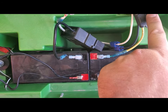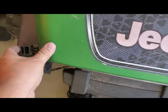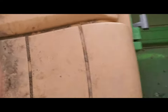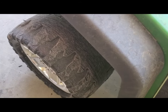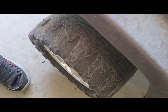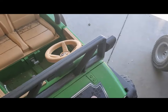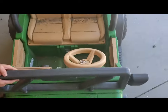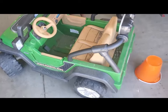Now if you close the hood, lock it up, and go over here — let's go to slow mode. My son calls it slow mode and fast mode. Look at the tire — that's the five mile an hour one at 24 volts. Hit the gas and go to fast mode. That just doubled the power. Now the motors in the back are not really designed for that, but they can hold it. My son will take it out for a ride and show you the difference between a regular 12 volt system and a 24 volt system.